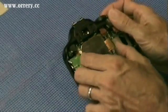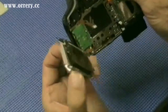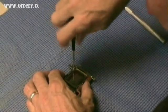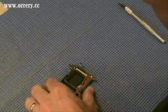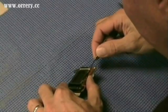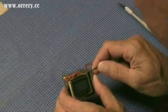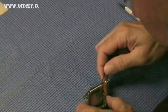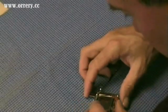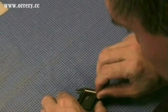With all those screws removed and ribbon cables disconnected, we can remove our CMOS assembly itself — lift it out of the camera body, being careful not to scratch the outer filter. We are now going to disassemble this CMOS assembly unit. On the top surface is what Canon has called LPF number 1. It is the outermost filter — the filter that gets dirty when the camera is exposed. It is held in by a metal frame that is just clipped onto the filter. Using a small Phillips screwdriver, work the two corners of the frame loose to pop it off, being careful that it does not fly off your table or scratch the filter.